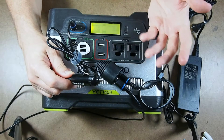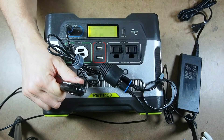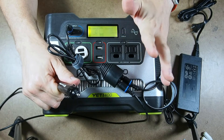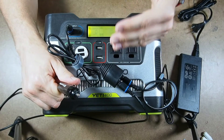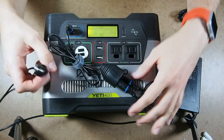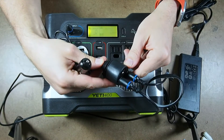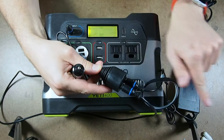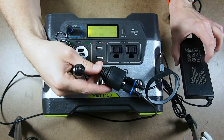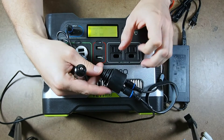So it won't drain the battery in the van, which is great — I don't have to unplug this all the time, and I can also charge my phone overnight from the van. But the main con is, since it's getting 12 volts DC and this is just a simple four-into-one with no diode limiting the power getting back, this goes into what's called float mode. So the charger gets feedback saying 'you're already at 12 volts, I'll just trickle charge you — I'll maintain you, but I don't need to ramp you up.'